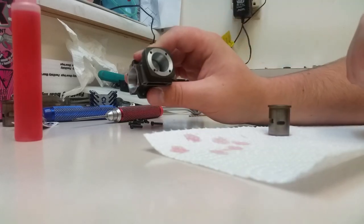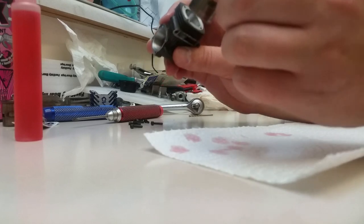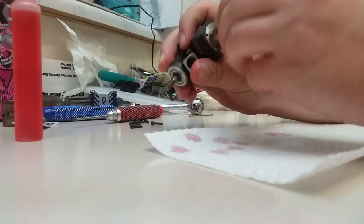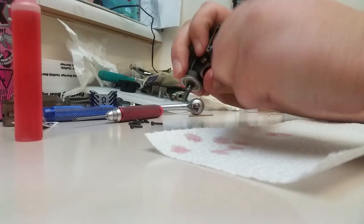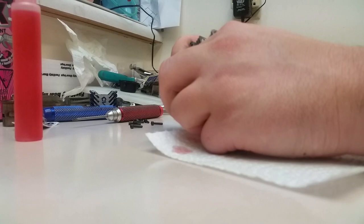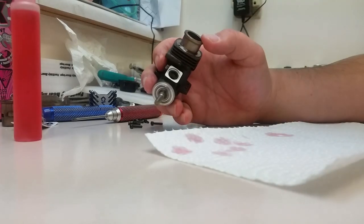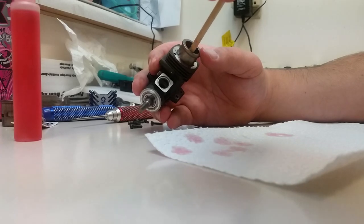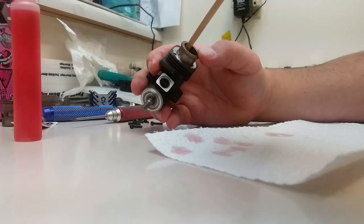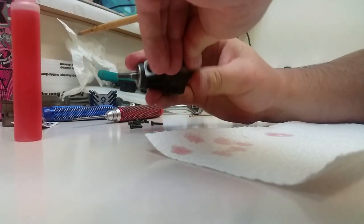So put our piston all the way at the bottom. Take our sleeve, there's a notch right there, and there's a notch, or a stake, or a pin in the block. A dowel pin, roll pin, whatever you want to call it. And this part can be kind of tricky, where you have to reach in there and poke the top of the piston to line it up with the sleeve. Try to avoid using anything metal. Okay, there it goes. After a couple little tries, it'll go.